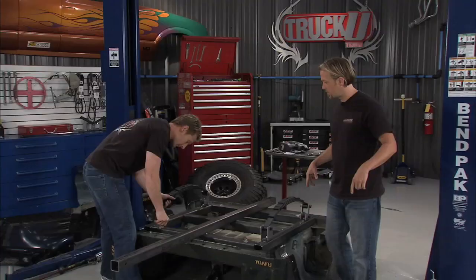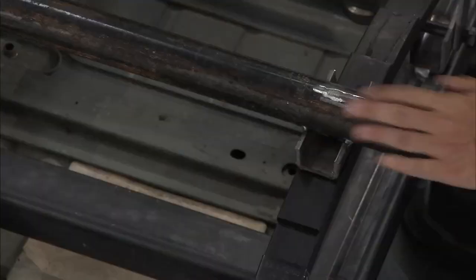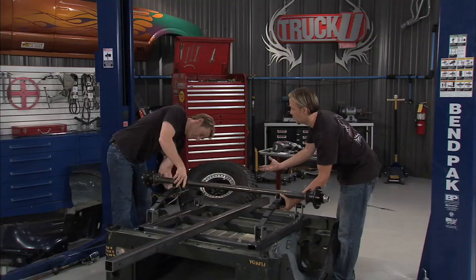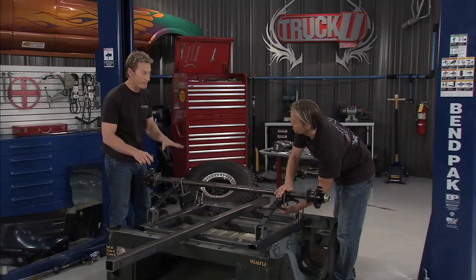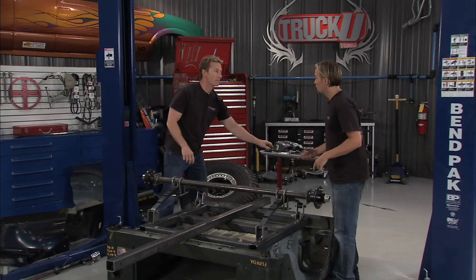We've got a couple of tabs we've welded on that'll hold everything in. We machined up these little plates that go on the bottom side, and our U-bolts go right through that to locate the axle and keep it in place — all we have to do is tighten everything down. Now, about the wheels and tires — Ryan and I were out doing a little hunting, and one of his buddies donated these. We convinced him it was for a good cause. 37s on beadlocks — it's going to look good and should be about the right height to match that Jeep. This is really going to come together nicely. We've got to tighten all this stuff up and bolt it all together, then we'll be back with more Truck U.